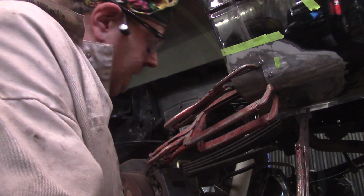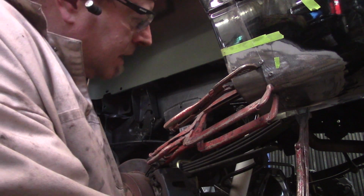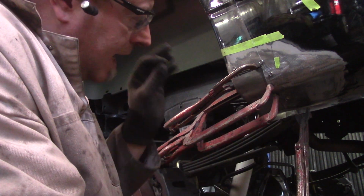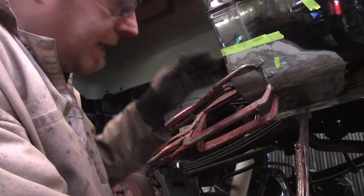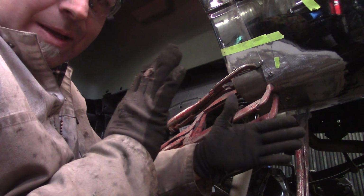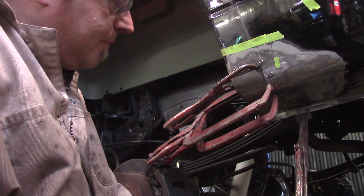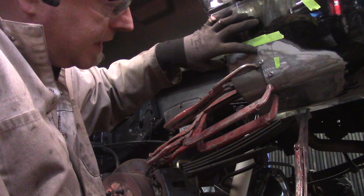Okay, I'm back. There's a little bit of a time warp here. So I fiddled with this a little bit more on the railroad track to get this fit a lot nicer. The other thing I did was I fit the outer wheelhouse and I fit the inner wheelhouse. So this gets a plastic mud catcher, basically, on the inside here, which also acts as a support for this panel, which I'm going to have to put back in. So I got a really nice fit here.